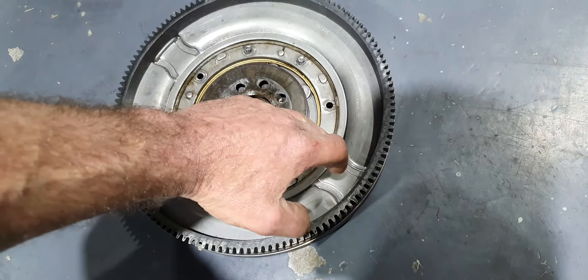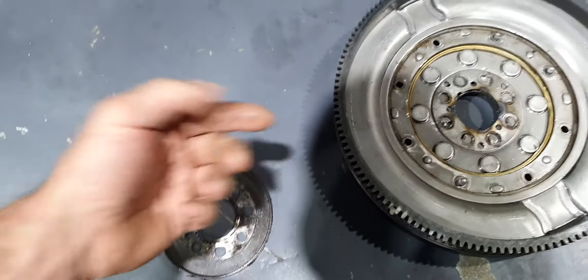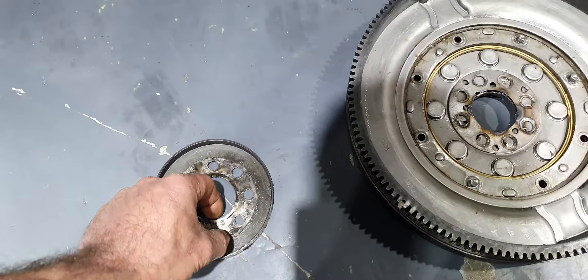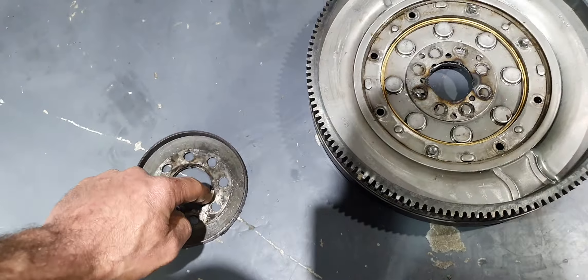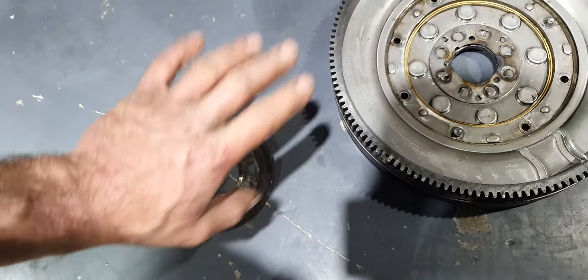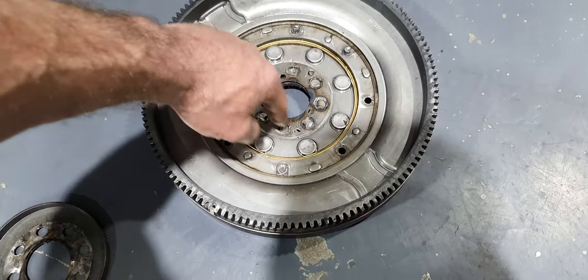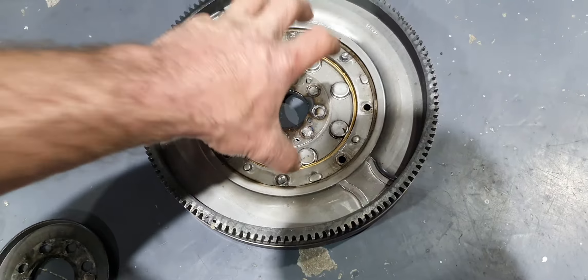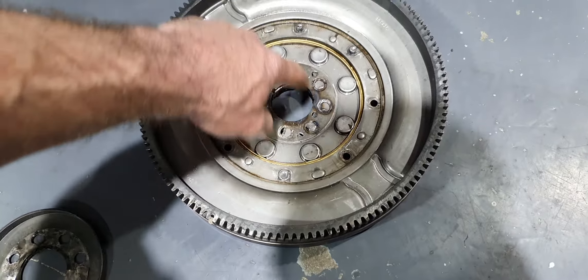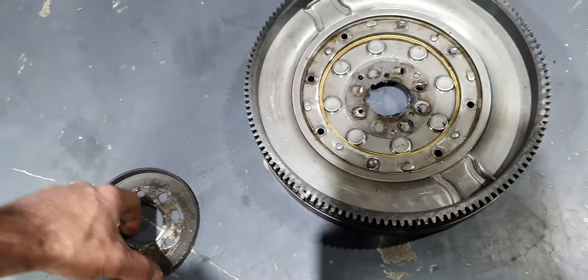To clean the face front — because you can play with the washers, there's a thin washer to give the offset. For example, if from the crankshaft you remove one tenth of a millimeter, you can get a washer and put the sensor one tenth of a millimeter more out and you're going to be fine. That means the missing material you add with a washer — it's not critical, we're talking about one tenth of a millimeter. The round area gets filled and then machined to center the dual-mass flywheel properly, because if it was only the bolts, it would make a wobbling movement — it won't run straight.